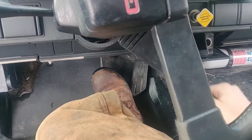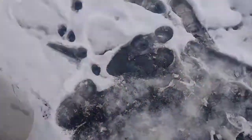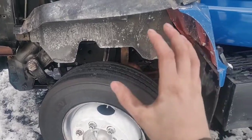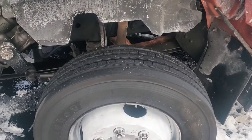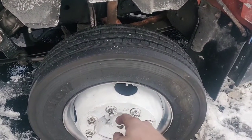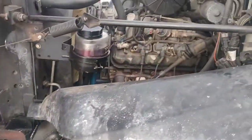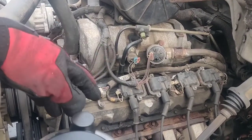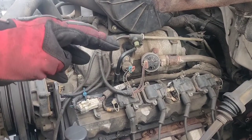Here's your parking brake. The calipers on the 2005 are the same for the front and back brake pads and everything. You'll need a 30mm for your lug nuts and a 30mm to take the large caliper bolts off. Don't cheap out on this when you're doing repairs — you need a very large impact gun. You're going to have those bolts stuck on there, and you'll spend 10 minutes just turning them out. There are four of them on each caliper.